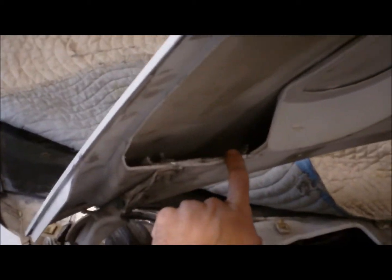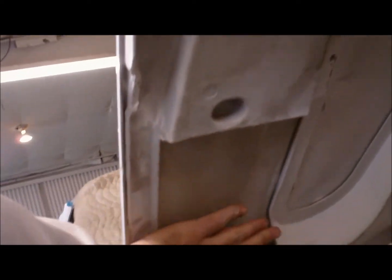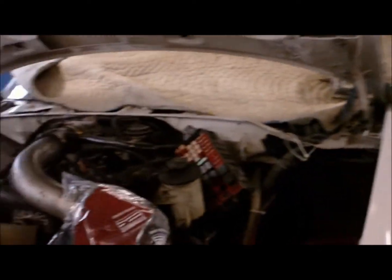I got to come back in here — as you can see there's a little bit of metal right there, kind of hard to tell — but I'm literally right in front of where the bracket mounts up. I had to cut it. The plan is to take this metal that you see right here, make a piece that comes up into the hood, and then I'm gonna fiberglass that all back in so it'll be like a tub in the hood, and that's gonna reshape everything.